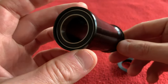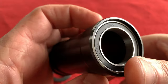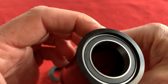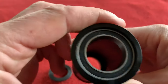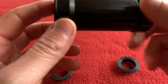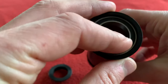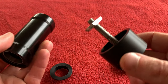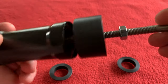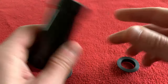It's got NSK low-friction 6805 bearings, and there's a one-year warranty on the bottom bracket. It's a fully serviceable design and the bearings are designed to be replaced quickly, with the tool that he made as well — that just fits in there and you press them out. That costs extra, so we're not going into that today, we're just going into the bottom bracket.